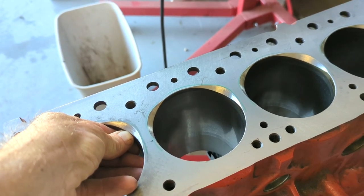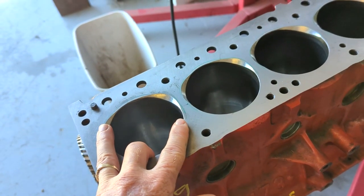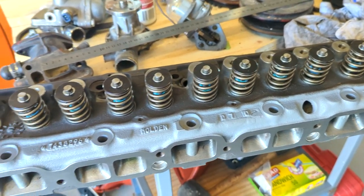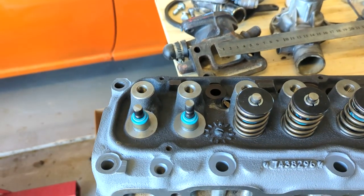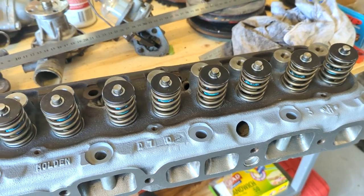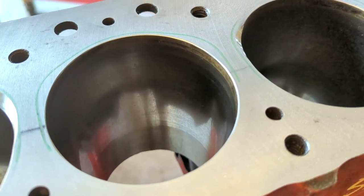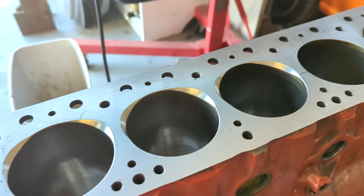I could come nearly 7mm down but I'm staying at about 5mm. I've only got the first two valves without springs on them - I went to buy a valve spring compressor yesterday and couldn't get one, but I'll get one next week. I want to take all the springs off and do measurements on every valve, making sure I've got the same clearance. It should be consistent because all the reliefs are basically the same. The method is: stick your gasket on, draw around it, and grind back to that line.